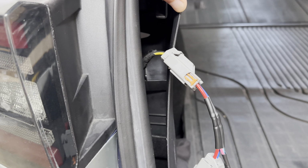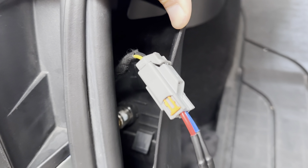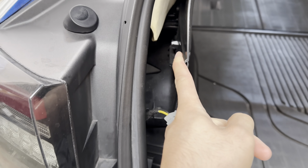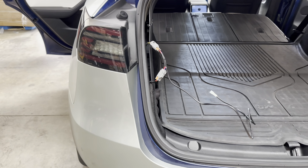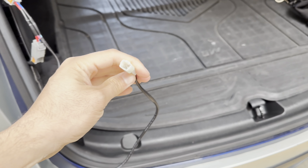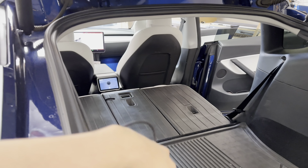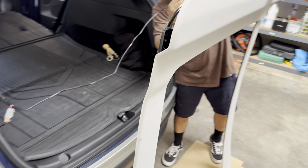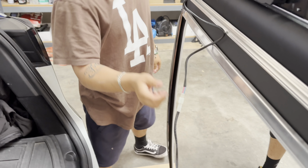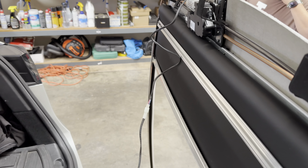this outlet. So you can see there, the trim, you just pop this open to the right, and this is from the rear left of the vehicle. Once you pop that open, you unplug the gray connector and then install and plug in the harness. This wire will run across the trim there underneath the rear headrest. So go ahead and plug in the smaller connector to the actual electronic sunshade.